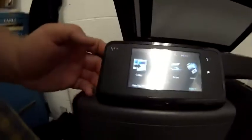It's moving very controlled. What it's going to do is move to the underneath, between the ADF path and the flatbed path. The light will come on and it'll actually read. There's marks under there it's looking for to help center and home itself. That's why you'll see little light flashes. So I'm closing it up.